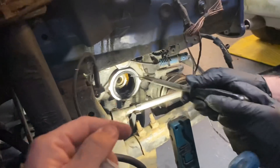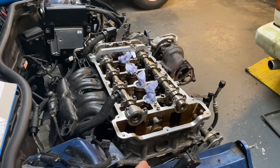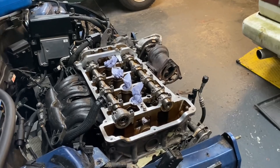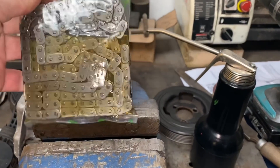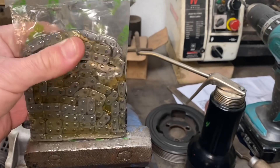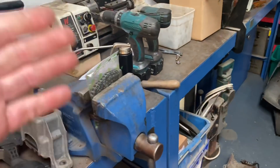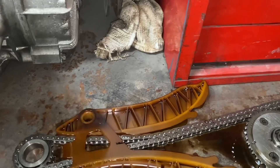It is quite a time-consuming thing. We'll see Chris pull that one out — that new seal is now in there. We are starting the process of getting the chain kit ready. You can see we've cut the bag open and filled it up with nice clean engine oil, and just massaged that in — let that soak for a good hour, just so that before the car gets oil pressure it's got half a chance. Everything's lubed up. So the chain guide — this all has to go together, but the chain has to slide in before you click these two bits together. And then you put the new cog in the bottom of it. I'll just move over to the bench — got a nice clean bit of cardboard there and Chris is laying it all out and getting it all ready to go.